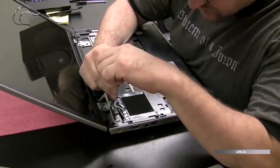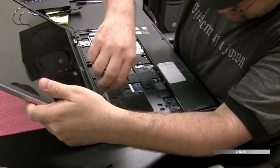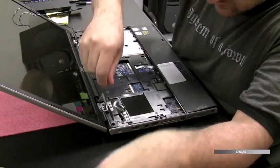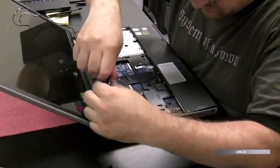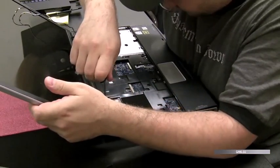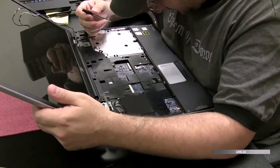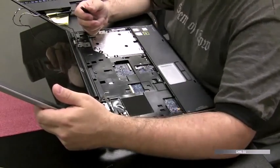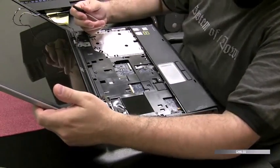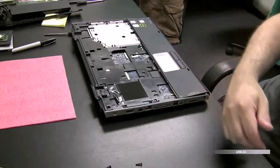And then once the screen comes off, we can get to the top and bottom case and get the motherboard out of there. Or at least get a good look at the motherboard. You'd be surprised when something spills in these things, the tiniest crevices the liquid could get into and cause a problem. You would not believe where the motherboard looks perfectly fine, but there's this one unexposed area, and once you expose that, you see that the liquid actually leaked into there.